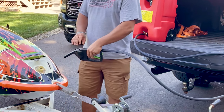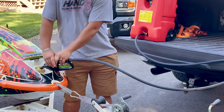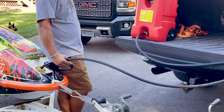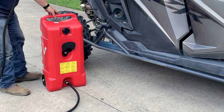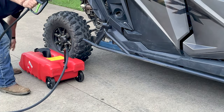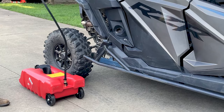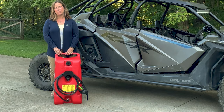When the Duramax is positioned above the tank to be filled, simply insert the nozzle, depress the child safety lock, and squeeze a couple of times to get the fuel started. The fuel will begin to flow in gravity mode. To stop the flow of gas, release the handle. Pro tip: to fully empty the hose of fuel, lift the hose up when the caddy is laying horizontally and both shutoff valves are open. And there you have it — the 14 gallon Duramax fuel caddy from Scepter.